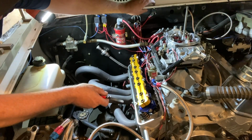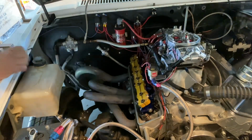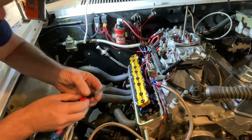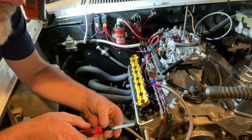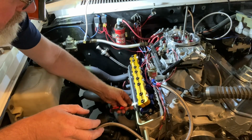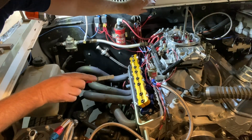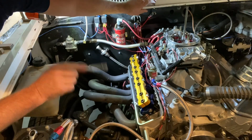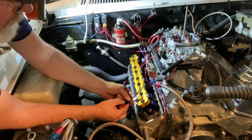All right, exhaust open. Okay. All right, exhaust open. I'm gonna check the intake. Should be 20 thousandths on the intake. Good. Now I'm gonna go until the exhaust comes back closed, the intake opens and then starts to close, and then you check the exhaust. All right, now you check the exhaust. Exhaust is 22.